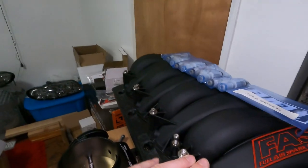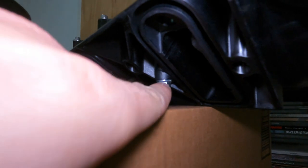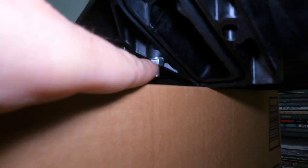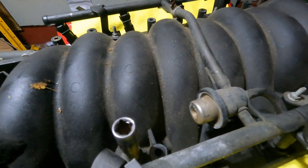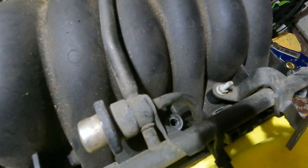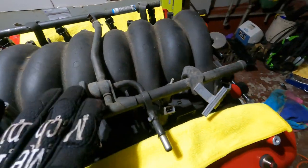I'm going to go out in the garage and take that lifting plate off the block just so I can get this started. If you look under here, I don't know why they put these here - I guess so you don't lose them, they should just put them in a bag. These nuts come off and they bolt down to the cylinder heads. We're gonna start by removing the four ten-millimeter nut slash bolt rods.